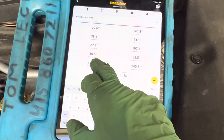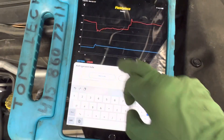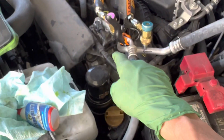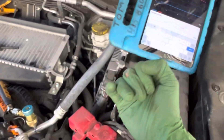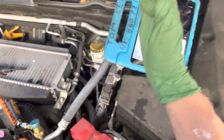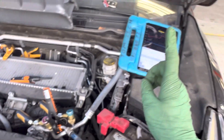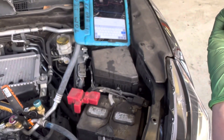Our superheat's climbing up to 10, subcooling came down to 32. Look at that on a graph — as the computer takes over. This is a variable displacement compressor; there's the valve right there. It is taking over and changing pressures and temperatures. There's nothing you can do with cracking off a little can and adding more, or taking out refrigerant to change those pressures and temperature, because once the computer takes over it starts changing the internals. That will just throw you way off — everything you've learned from fixed piston compressors just gets dumped into the garbage can.